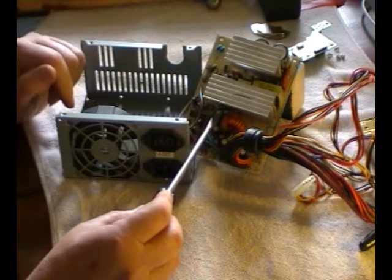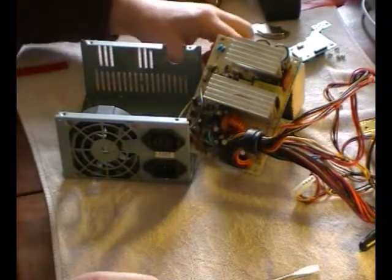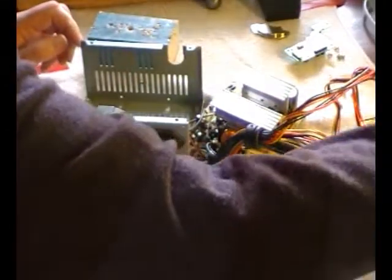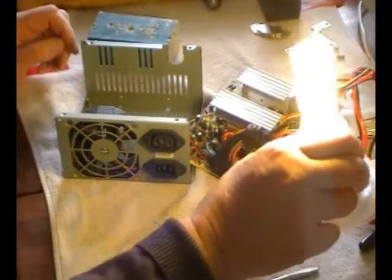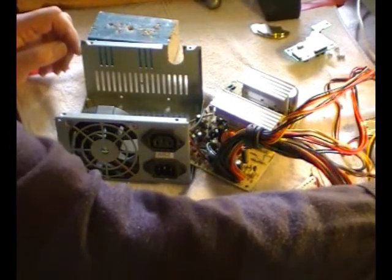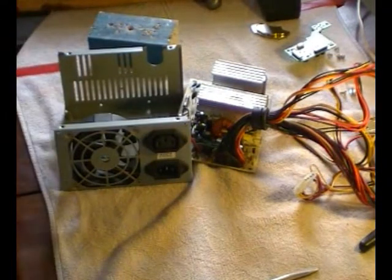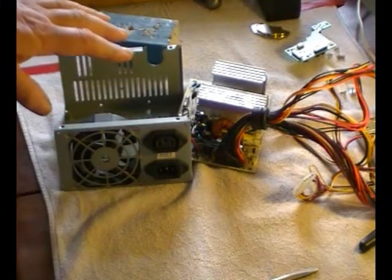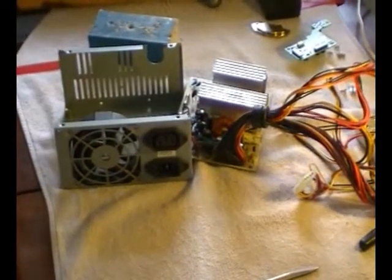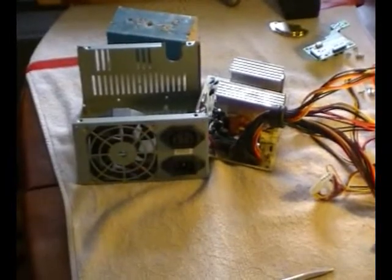And what I'm going to do is I'm going to pull the camera in, put the printed circuit board down, and pull the camera in and show you that one more in close-up. I think I'll put it flat. Right, there we go. And yes, unless the capacitor goes dead short circuit, a unit can still work with a gassed capacitor. Sorry about the long delay there.